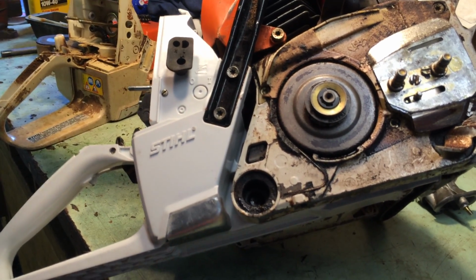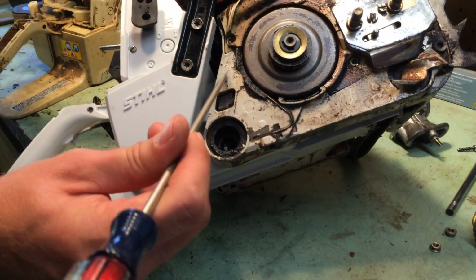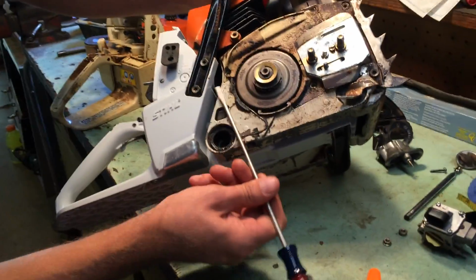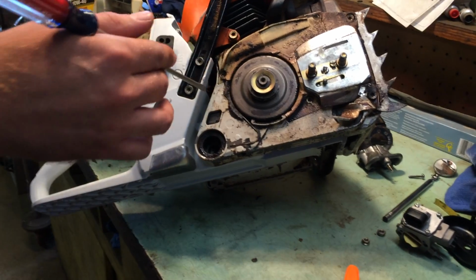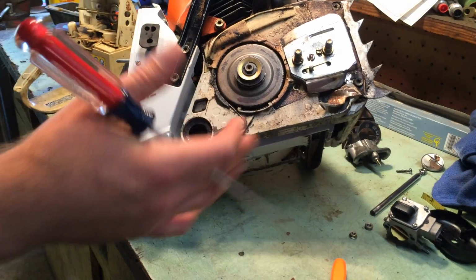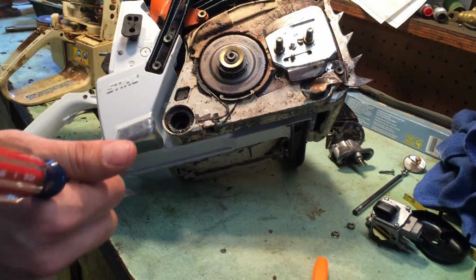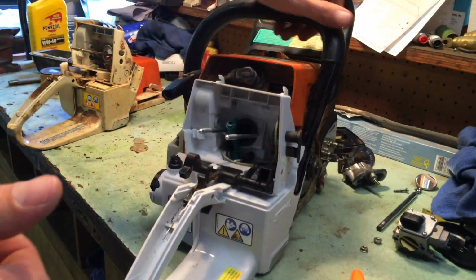It's pretty easy to do. I just took a long screwdriver and just gently pushed. Obviously, I wasn't trying to protrude, wasn't hitting the rubber with this. I was actually pushing more against it in this type of fashion here. And a long set of needle nose pliers is really good for also getting that vacuum hose hooked back up to the motor. It's really quick and easy. You have enough room to work with it without having the mount bolts installed. And of course, the assembly is reverse order of installation.